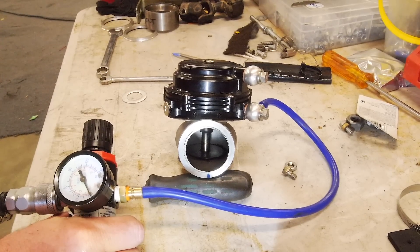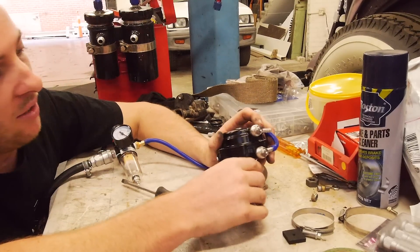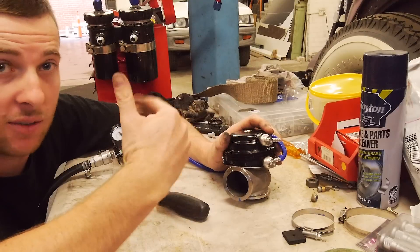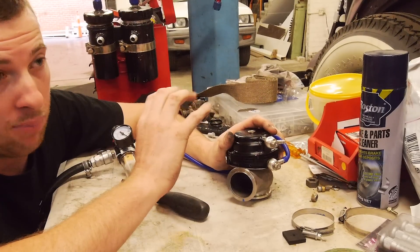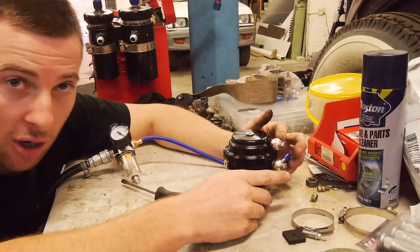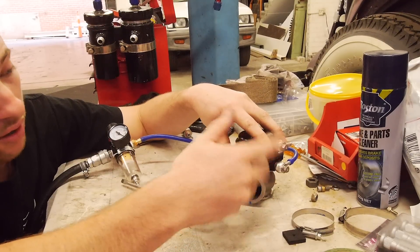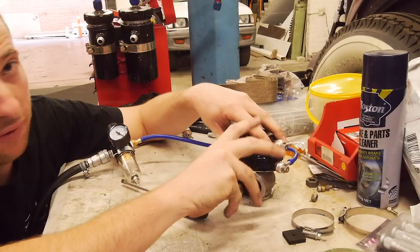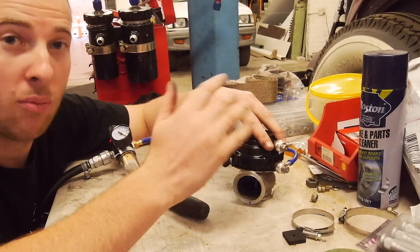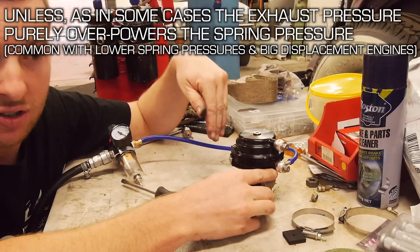So in a nutshell, that is how you check your wastegate spring pressure quite easily. It might have been showing cracking at five pounds, but there's one thing to remember: if you're running purely off the wastegate spring, yes that will be what happens because it's purely mechanical. Whereas if you're running a boost controller — particularly an electronic boost controller — you're going to have boost going to the top of the wastegate which pushes in the opposite direction. So this spring is effectively between 12 to 15 pounds, and with an electronic boost controller you can go double, if not a little bit more than double, the spring pressure.